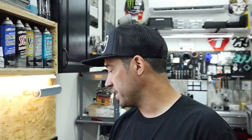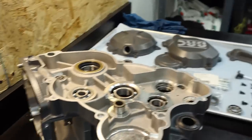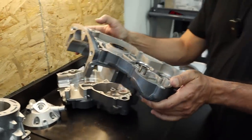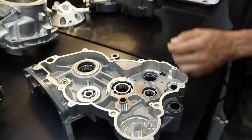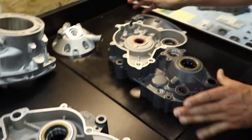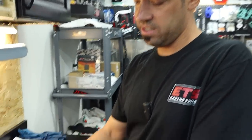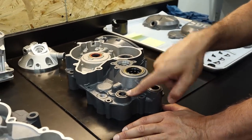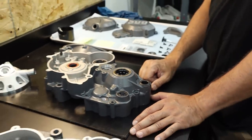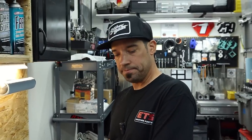Bearing retainers, we gotta put the kickstart boss in place because all that stuff was now in our set of cases here. Got all the seals done. This was the one side I think that we captured. Yeah, if you guys missed it, it is in the last episode of the 2023 Hellfire build. Bearings and seals. Seals in place, counterbalancer, left side main seal, counter shaft, and our shift shaft seal. Yeah, we got our case bushings in the arse end of it there. Yep. Cool. And today we are going to focus on trying to get the bottom end closed if we can.